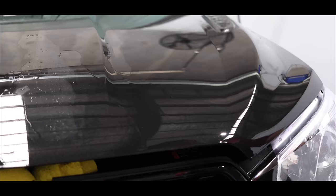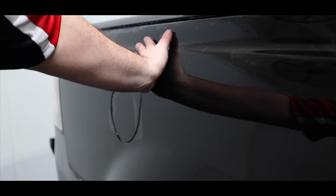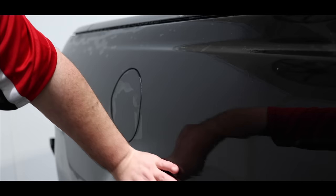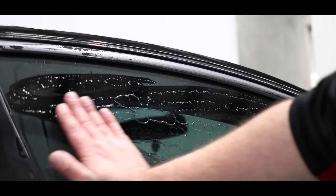A final inspection that visually and physically inspects the paint and trims is a vital process. I couldn't see or feel any remaining fallout or road particles on the paint, meaning that there was absolutely no need to further clay the vehicle or use further cleaning chemicals or processes. The water behavior was flat and pooling, and the paint felt clean with a touch of grippiness, all pointing to a clean bare finish, which was fantastic.